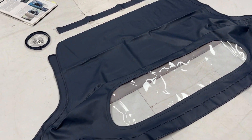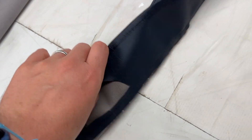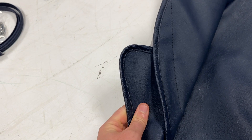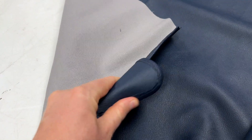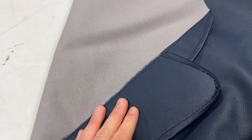So let's show you the basics. It's a soft top hood with a flyback plastic rear window stitched in — it's a sort of oval shaped window going around there. You have the reinforcement elements going around the back section, which is double thickness, and that allows for the bar element to get fitted that goes underneath the eyelets and domes at the back on the rear deck area for fitting to the car. A feature on the 100-4 soft tops was a little metal panel in the front part here — we do not supply the metal panel; we replace it with plastic, which I can feel in there. You can feel me bending it. If you have your original metal then you simply remove that plastic piece and replace it with metal, but if you don't have the metal then the plastic does the job.